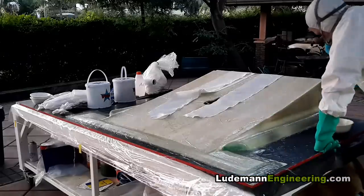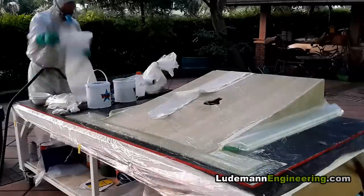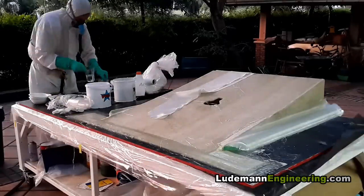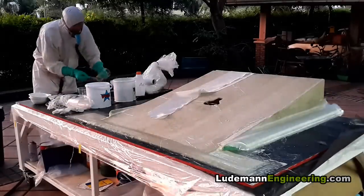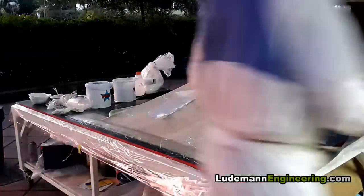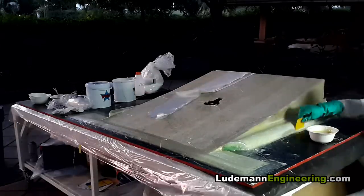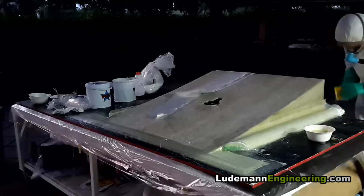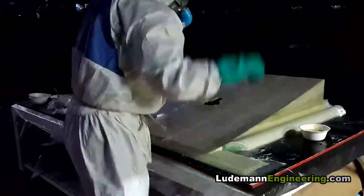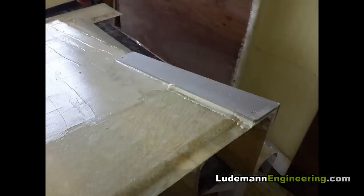As you can see, our light is fading rapidly here — working as fast as I can. Oops, run out of epoxy, time to mix up some more. You can see my breathing apparatus — it's powered by a blower about 30 feet away — and a Tyvek suit which covers my whole body and nitrile gloves, thick industrial strength, to try to keep the epoxy off my skin. I thought I had developed an allergy to all epoxy; turns out it was only the micro balloons. So there's the finished — almost finished — version.